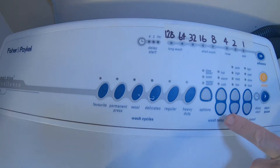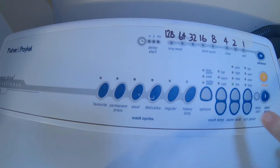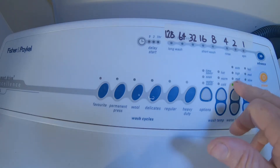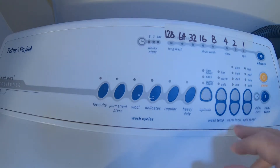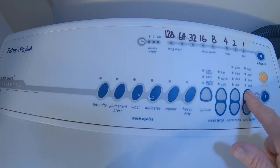The thing we need to do is turn on at the main switch, then hold the temp wash button down, and then push the power button. You'll see a light come up — in my case on the low setting. On the earlier phases they say to push the advance button, but on this one we only need to push the spin speed button three times. And there we have it.